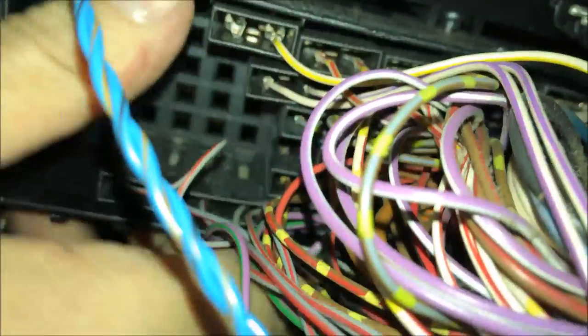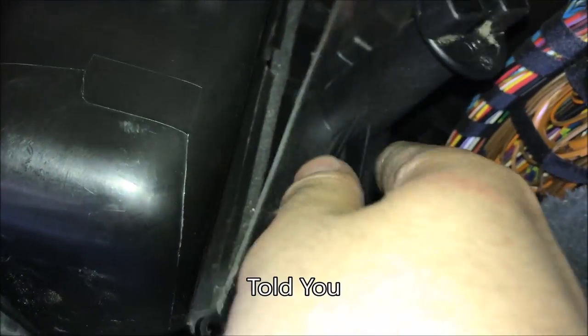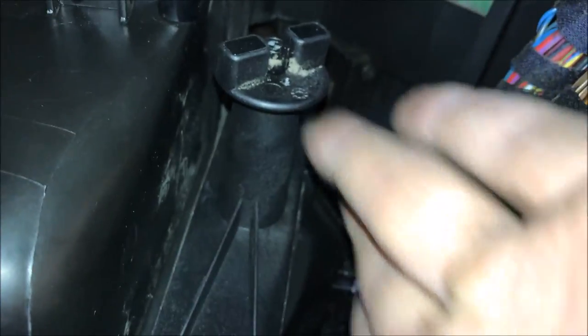If you'd like at this time, you can take that electrical box so you don't forget — go ahead and slip the clips back on and make sure it doesn't move. When you put this cap back on, you have to make sure that the filter is pushed all the way in and pushed all the way to the left. Otherwise, the spikes on this cap will be hitting the filter itself. You've got to make sure that none of the foam piece is visible. You just push it as far as you can and you don't see any of the foam. Now you can put the cap back on and then turn the knob at the top. Make sure that the air filter cap is on and tight. Next, you have to put the air filter duct back on. Make sure this hole is lined up with the little plastic screw. Plug in the panel light and then put it into place and then finally go ahead and screw it back in.